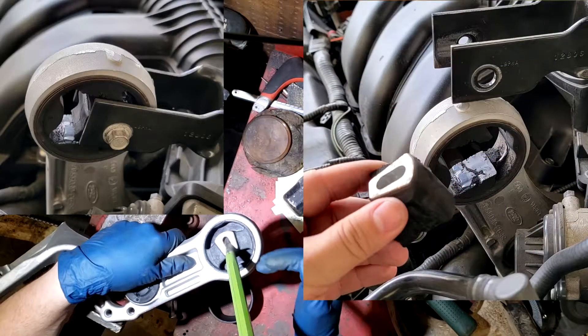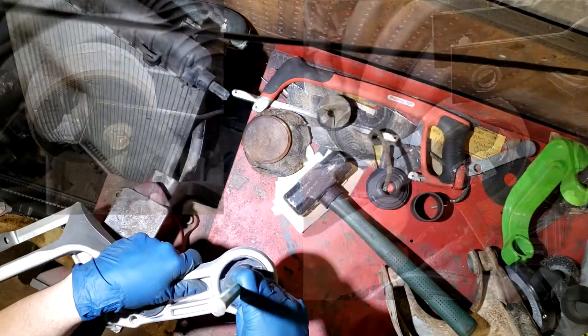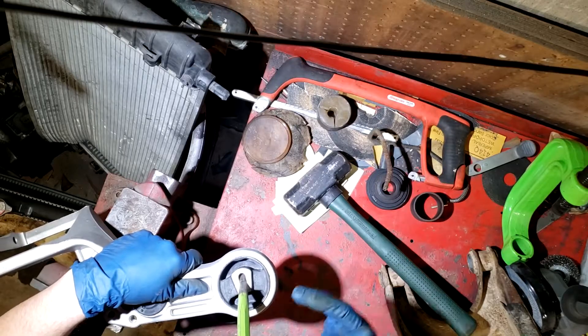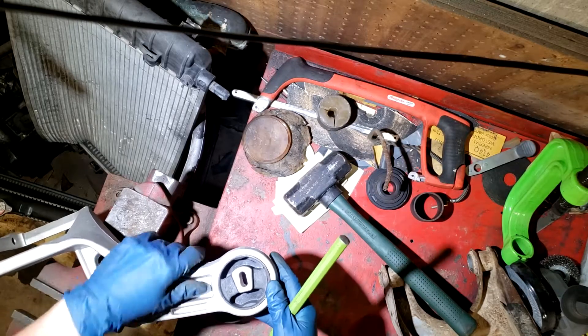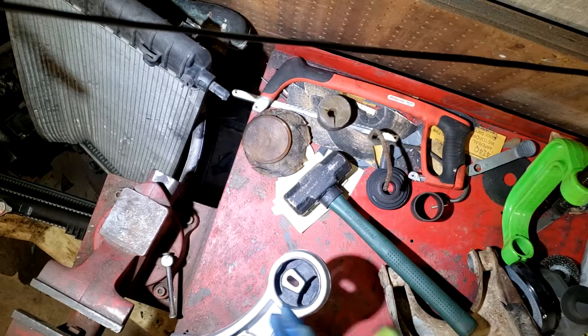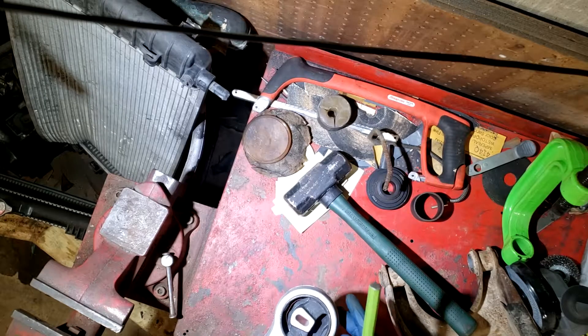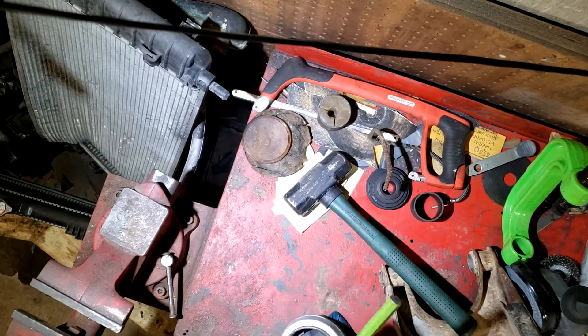Where the engine bolts to here, the engine will be able to slam back and forth. Some people think there are issues with the transmission because they feel that hard slamming and think it's slamming into gear, but it's just the engine mounts. It seems to be the geometry of the design - for whatever reason they just don't hold the engine very solid, and that destroys the mounts.